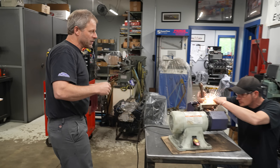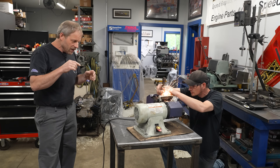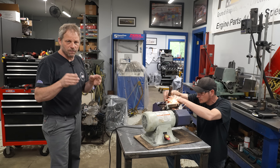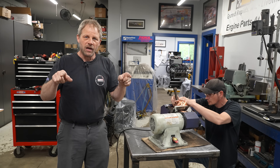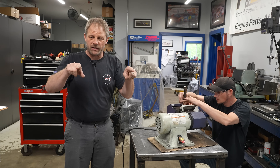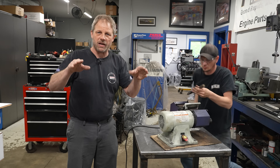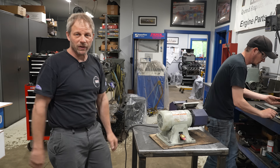John's going through and taking the big end of the rods and grinding off the weight pad to make them the same weight. You have a rod that has your small end and your big end, and on the balance beam over here you scale and measure individually the big end and the small end, and you make them all match. That makes a balanced rod - that's the starting point.